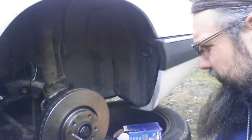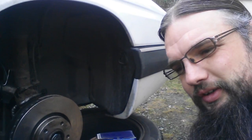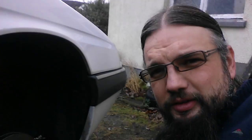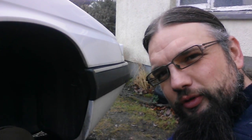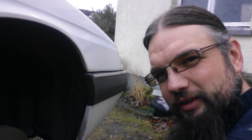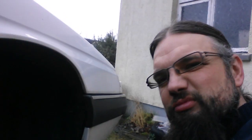This is the new disc in place, and you may be thinking these tiny little screws — is that really all that holds the brake disc on? But of course it doesn't, because the wheel bolts go through the disc to bolt to the hub. So effectively the wheel is helping hold the brakes on. So don't worry.